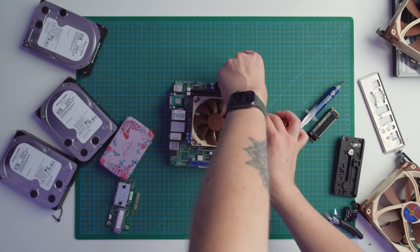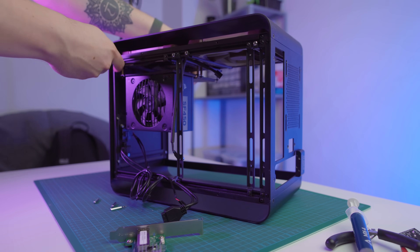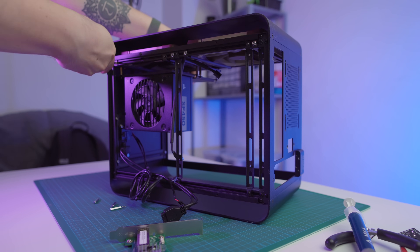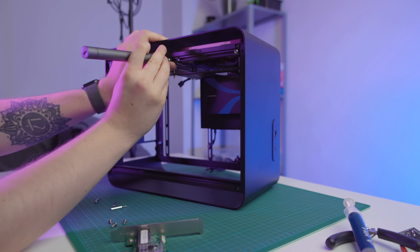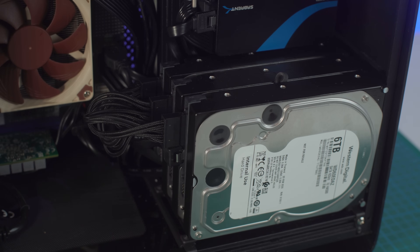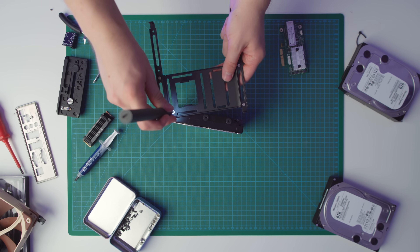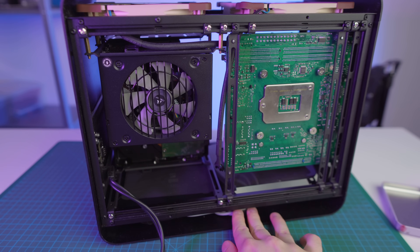Since I've done my fair share of ITX builds over the past three years, building in this case wasn't too difficult. I used vertical brackets to mount a couple of Noctua NF-A14 fans at the top — two 140mm fans are more than enough to cool this enclosure and components seem to be running cool. I used some standoffs for the PSU and drive bracket so the 2.5-inch drives just barely clear the 3.5-inch drives at the bottom. I used rubber grommets between the vertical rails and the hard drives to minimize vibration, and also put rubber bands between the drives themselves. I decided to separate the server part and the PiKVM part using the stock dust filter, though accessing the Pi later would be a real pain.